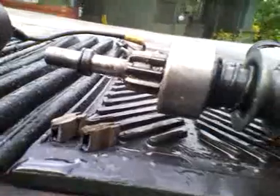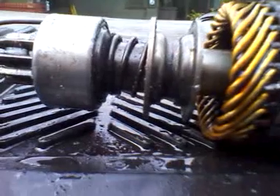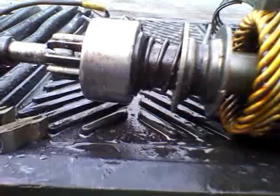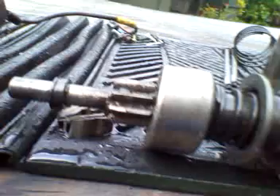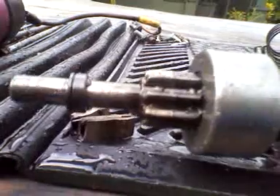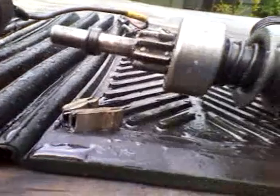This is the one that came out of the car — the small block Chevy motor out of the 1970 Chevelle. I was having problems; it was just clicking. I think the Bendix was just coming out and not spinning. The car has a small block Chevy motor with a three-speed manual transmission.